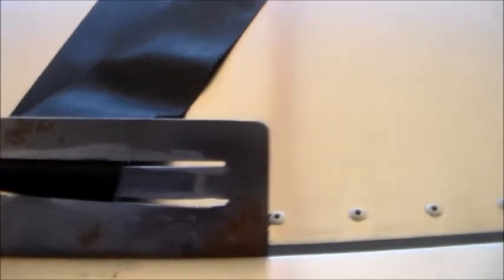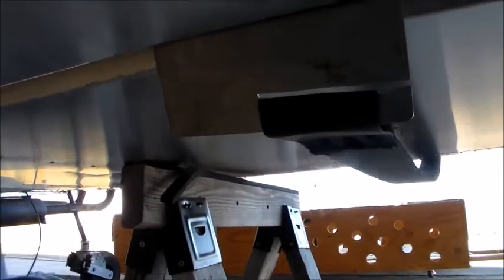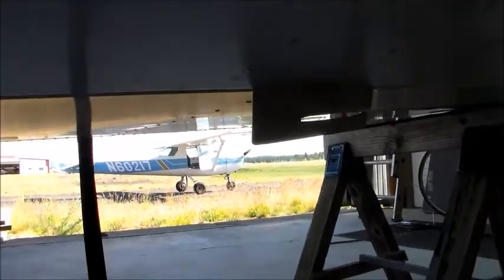The bracket goes into the gap in the aileron and then folds back on itself — the webbing is right there. Looking below, you can see that same strap, and hopefully you can see the slot in the bracket where I'll put the webbing. Now it's there, and when I pull this top piece I'm tightening that up, and then this steel bracket will take the weight and distribute it across the webbing. Then I do the same over here, two rib lines over, same process.